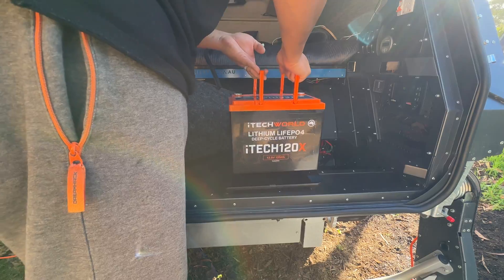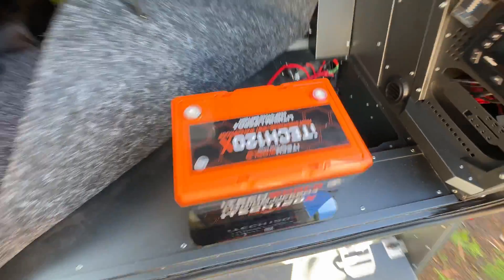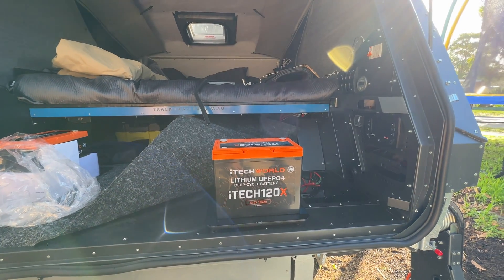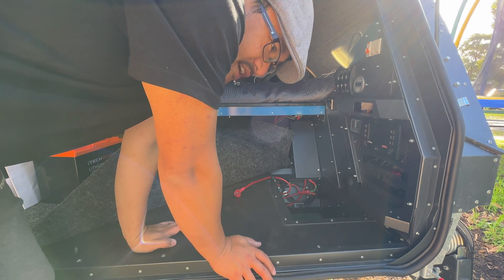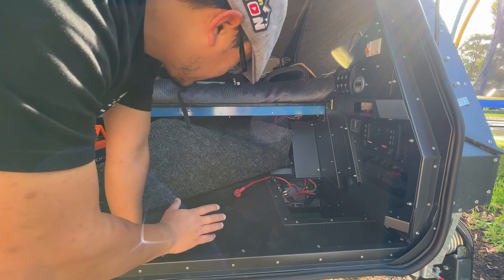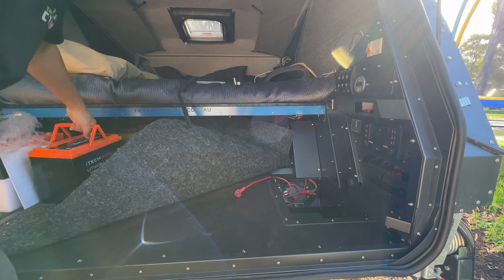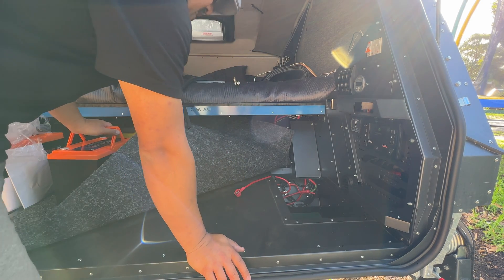That's a lithium. How heavy do you think that is? 10.2 kilos. And this has the same 105 amp hour rating. The AGM was actually three times the weight. It's not uncommon knowledge that lithiums are lighter, but when you actually see it in person — in the actual process of weighing both an AGM and a lithium battery — you don't realize how much of a difference that is. If I had put two 105 amp hour AGMs in, that would have been nearly 61 kilos. But I can put two of these in, and that's not even the weight of a single AGM, so you can see the benefits already.